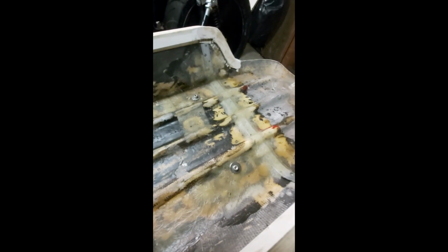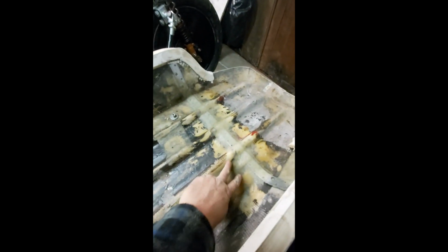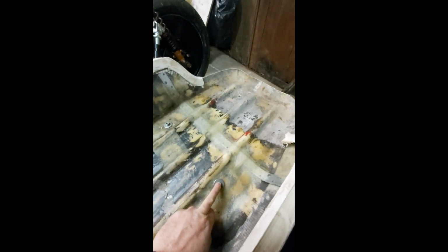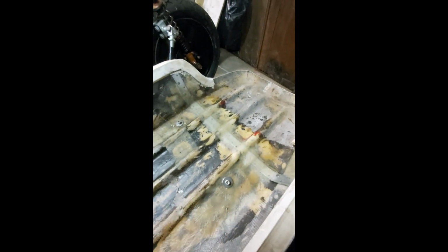The reason for that is there will be a metal plate going in here later on, sort of like a reinforcing plate, and there'll be M10 bolts going through it afterwards. These are just to hold it in place while I do some more work. So the sidecar is now in place and it's rock solid, in its final position.